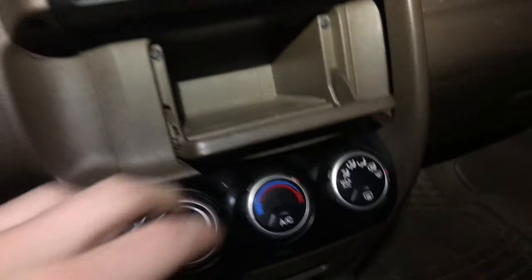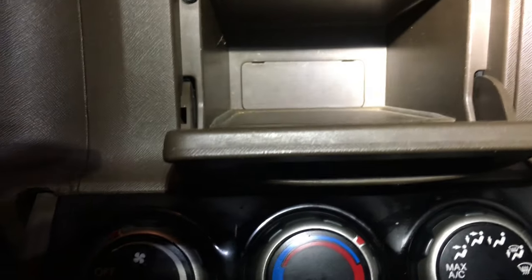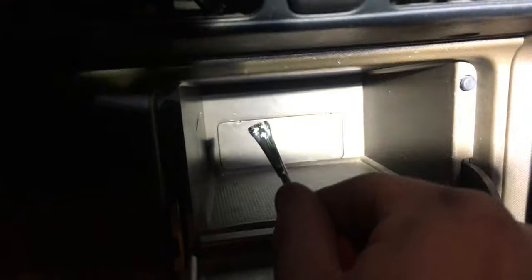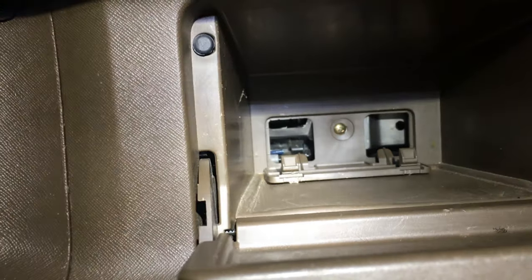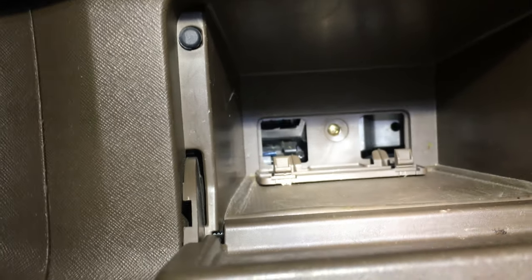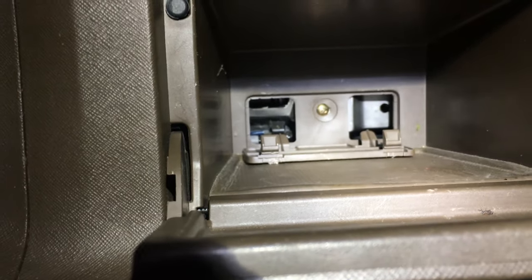With introductions out of the way, first clear out whatever you have in your main center console — we're going for that tabbed access point in the back. You can try to get it off with a flathead screwdriver or your hands, but that's a real pain. What you really want to do is use something like a paint can opener. It's really useful because it gets into those little indentations and pulls it free. Also, for this entire installation it's very beneficial to have a headlamp — there are some really dark, difficult-to-reach areas in here.